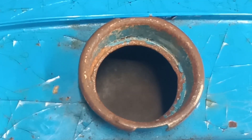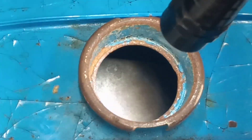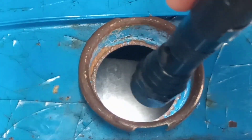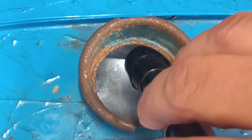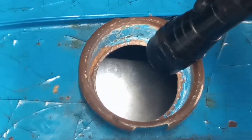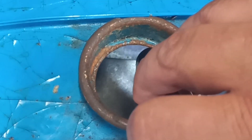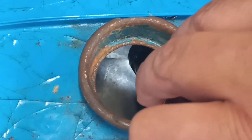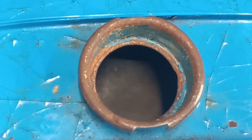There we have it. I've drained off the citric acid, it's had a good rinse out with very hot water, then methylated spirits through again to chase out the water, and then a little more of the heat gun. I'm shining my bendy torch in there — you're probably seeing the back wall of the tank, that grey colour. That's very typical of the finish you get with citric acid. It's perfectly clean — you could put petrol in that tank now. You can see marks where the rust has been removed, and it's all gone. It certainly works for me.